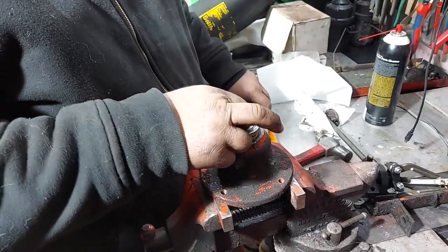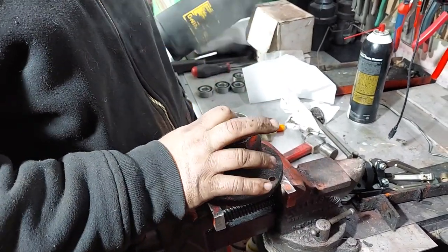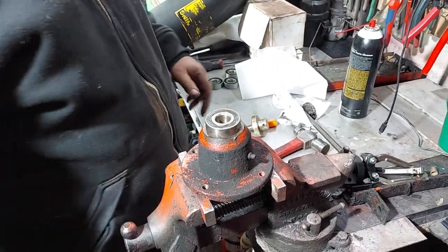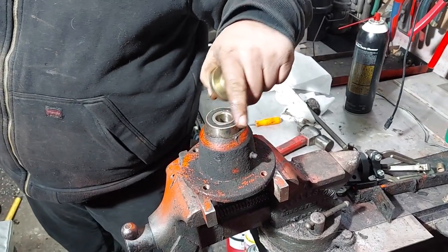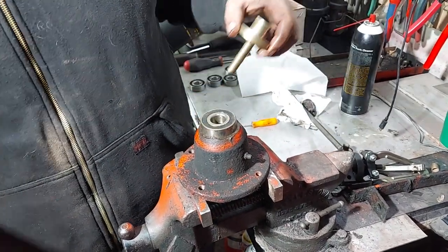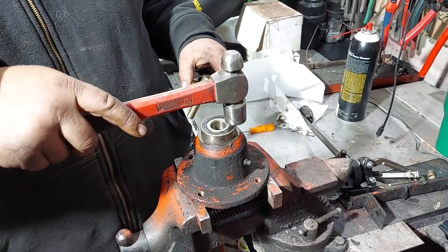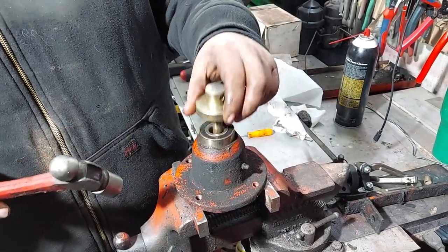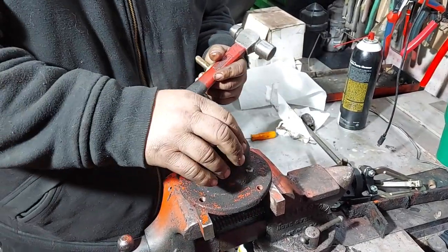The key is that whatever you're using is pushing on the outside of the bearing — not on the rubber seal, because you'll damage the bearing — and preferably not on the inner race. You want to be on the outer race. They should go in pretty easy. If your housing is rusty you'll have to clean it up with emery cloth. A dead blow is ideal if you're not going to use a socket or mandrel. If you get a socket that fits the outside, that works. Using a mandrel puts even force on it — with a hammer you're hitting one side and have to keep working your way around in opposing directions: 12, 6, 3, 9. Make sure when you set it in that it's sitting straight and not crooked.